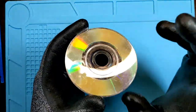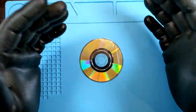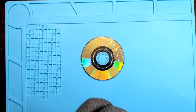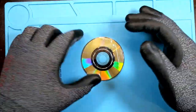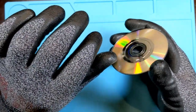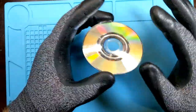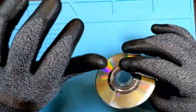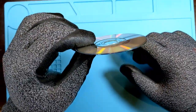Aesthetically, it doesn't really matter. A lot of discs I show on here won't look mirror-finish perfect, and there's no reason for that. Rule of thumb: if you have a scratch and you can feel it with your fingernail rubbing along the disc, that scratch is deep and wide enough to impact functionality. If you can't feel any scratches at all, chances are the disc is fine.